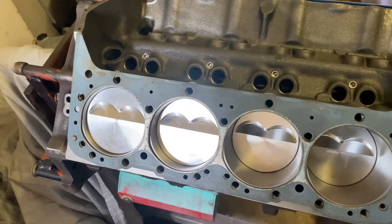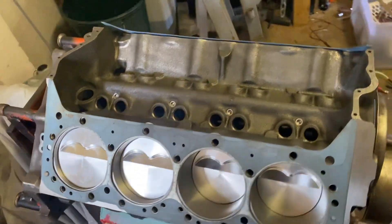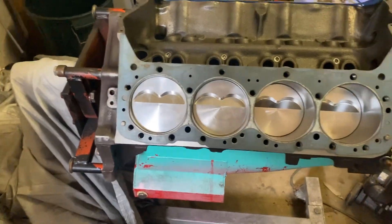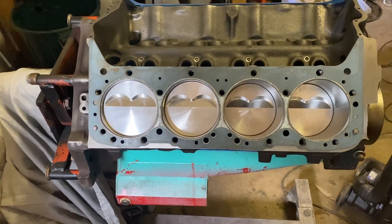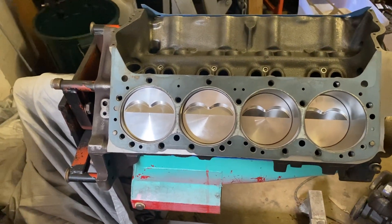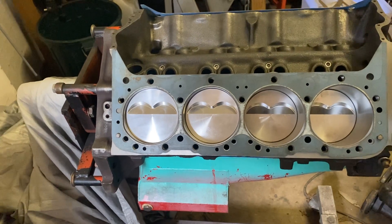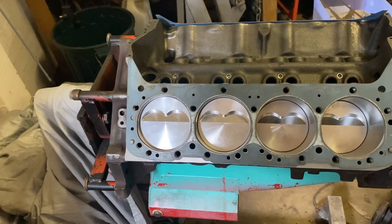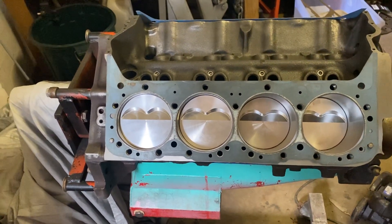Back on the small block again, just a quick update. I basically stopped working on it about a year or so ago — I had dramas with the block. What I found is the pistons were hanging out of the block by about 30 thou. When I sent the block to the machine shop, it was already at zero deck height, and what the guy at the machine shop did, he must have decked it even more. I didn't actually ask him to deck it — I just wanted it bored and honed, washed, cleaned, all that sort of thing. And yeah, like I said, it's about 30–33 thou hanging out.